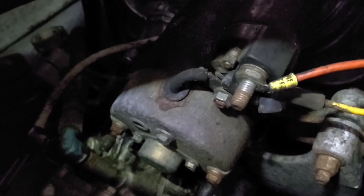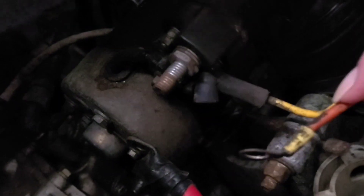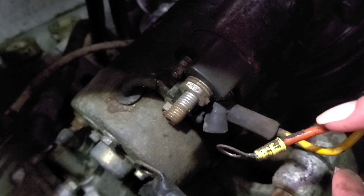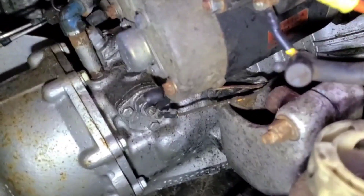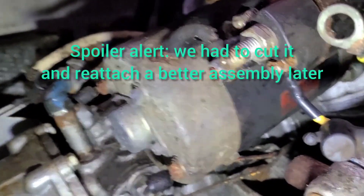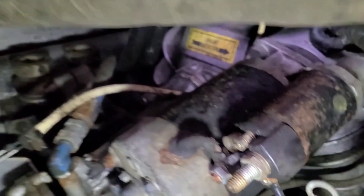This red wire just comes out of here, and the orange one will come off behind it. Now we have the yellow one — it looks like the same size but it comes underneath here, and that might be a plug. The next thing we need to do is get this little yellow wire off of this tiny little bolt, which is proving difficult because the bolt is super tiny and it's really hard to get anything to grip there. We may pause on that and go try to get to the two main bolts holding this starter motor in.